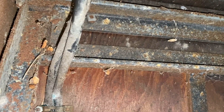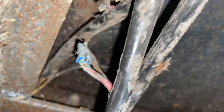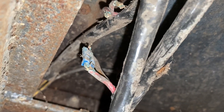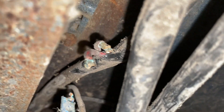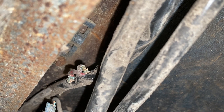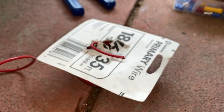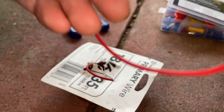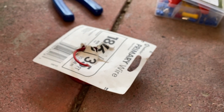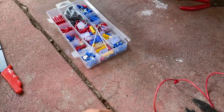We have a view of underneath. Let's troubleshoot this wiring — we've done a bench test, the horn does work. The more I look at the wiring the more I'm concerned. I found that this is the hot coming from the battery, and that's very blue — this looks totally corroded. So what I'm going to do, regrettably, is just rewire it, because I have no idea how good this wire is. I put the first one in, going to do the second, and just slowly go through this. It's going to take quite a while. We've copied this lovely arrangement — we'll put that up there and just keep going.